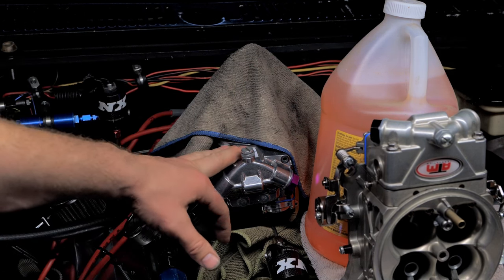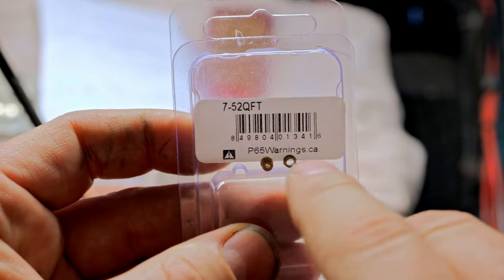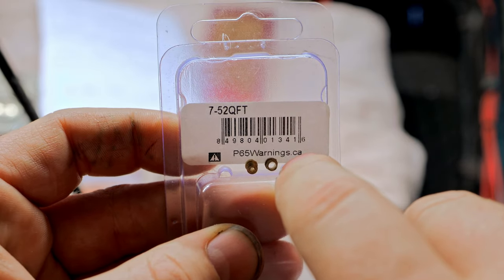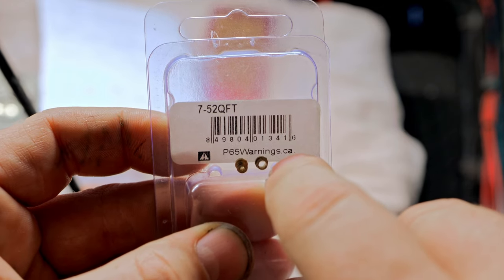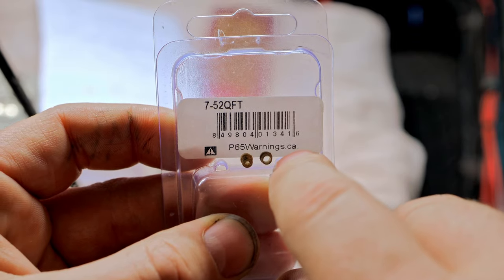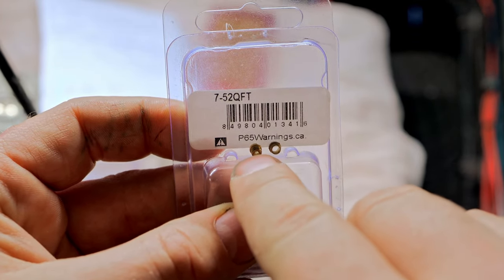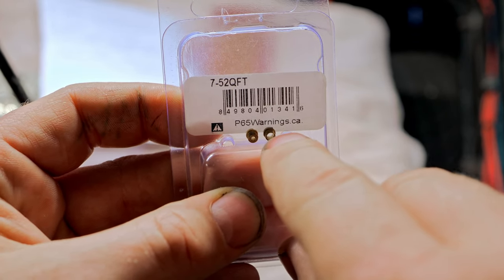And the reason I'm resetting it up, here's two power valve restrictions, and you have to have a carburetor that allows you to adjust these. You can see, look at that one. That's one that I was trying to get good economy at the E85, so I was going down on my main jets in the front and using the power valve mostly for enrichment whenever it needed it. And you can see this one is more the one that I really need for gas. So I'm going back to gas. I had to throw these in there because I didn't have any of them ordered.